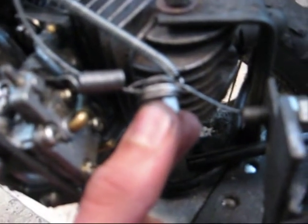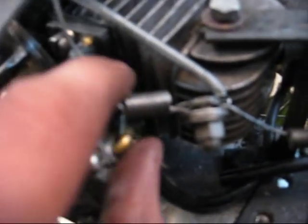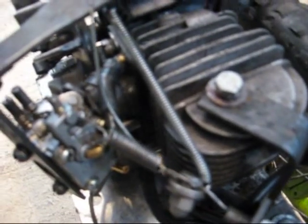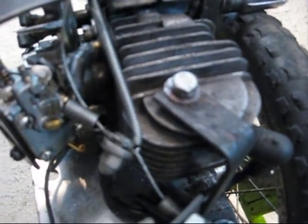This is a confusing part — it goes into one of these nuts, which most bikes have, which has a hole in it. And then on the other side of that there's this spring, which goes onto the butterfly, and then there's this return spring so that it returns it. You can see that it's pulling it, and you can see that butterfly there opening and closing, and that return spring is just returning it. If I didn't have that there, the friction in the bike cable would be too much, and the butterfly wouldn't return — so I'd just be stuck open all the time.